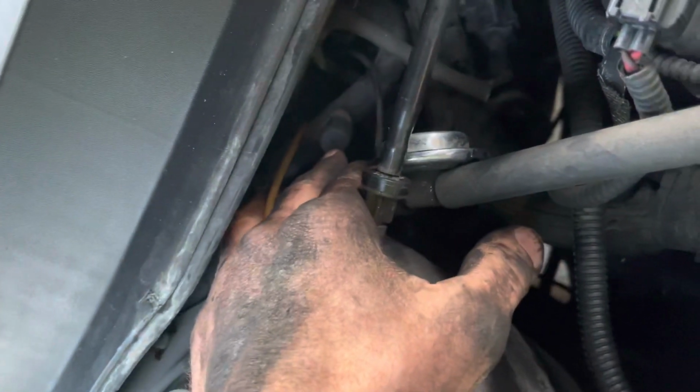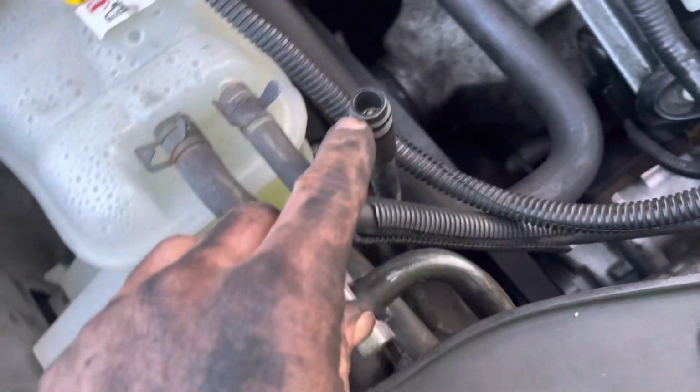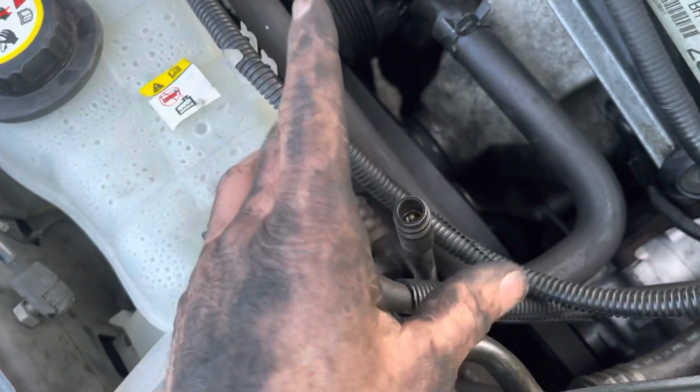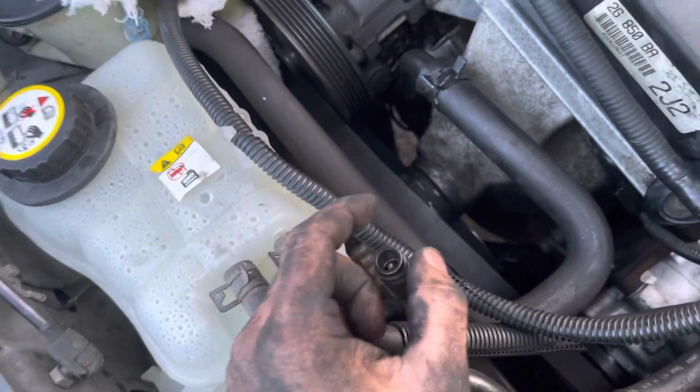And while you're at it, always replace those little valves, those Schrader valves, at the top of these ACs if you suspect any kind of leaking at all. Heck, 22-year-old car, you pull those off with a little valve, get the metal one, not the plastic one, and you put in the proper size. Keep the old ones because you're going to need them at the parts counter.